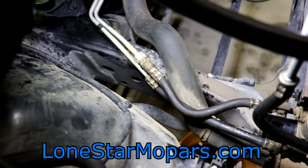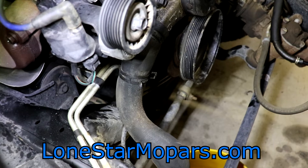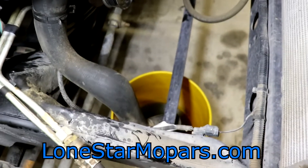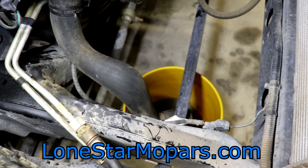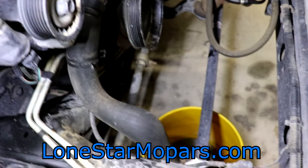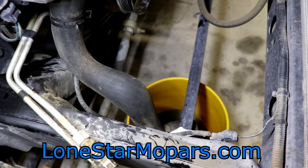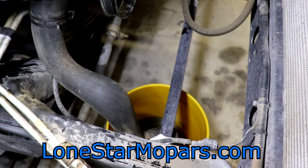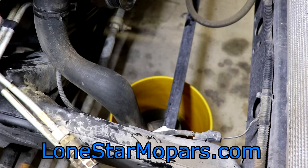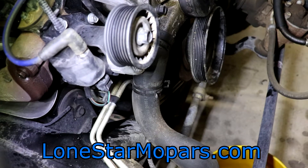I've got the clamp down. Boom — silky smooth off the radiator. Keep in mind even though we've drained the radiator there could still be fluid — prepare for a bath; have rags, buckets, containers handy. Not a single drop hit the floor — not a single drop, even on the glove. Amazing. Planning things out sometimes has its perks. Now with that in place we'll look at the lower radiator hose off the water pump — not a ton of fluid but just enough it could ruin your night.